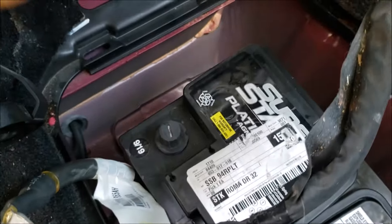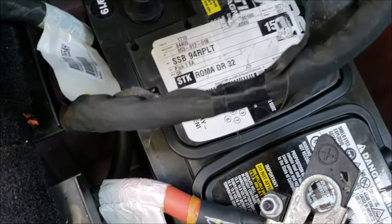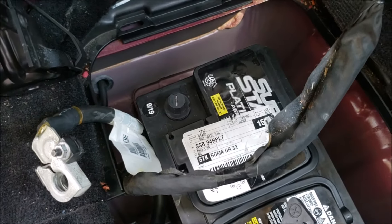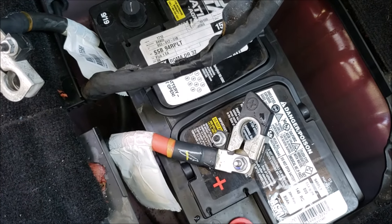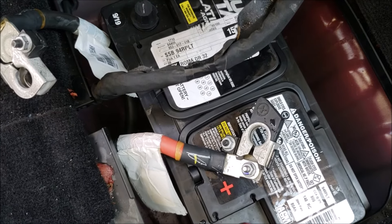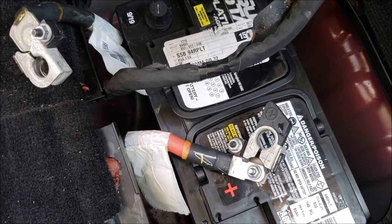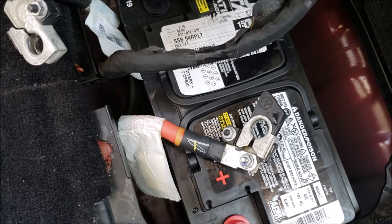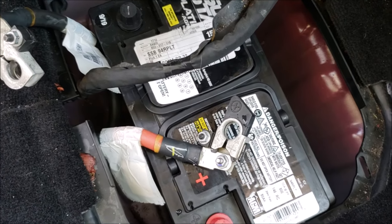But before all that, I gotta put this hold-down to keep the battery in there. I was going to do the voltage test on it right now — the old battery would read 12.5 volts disconnected, but once I plugged it in it would drop to 12.2, and once my key was in the run position it would go to about 11.9 to borderline 12. That's the reason I was swapping out the batteries.